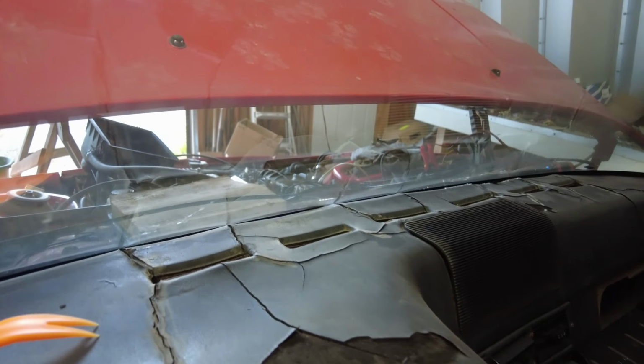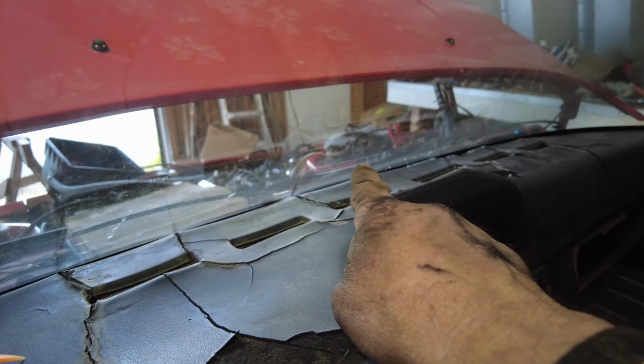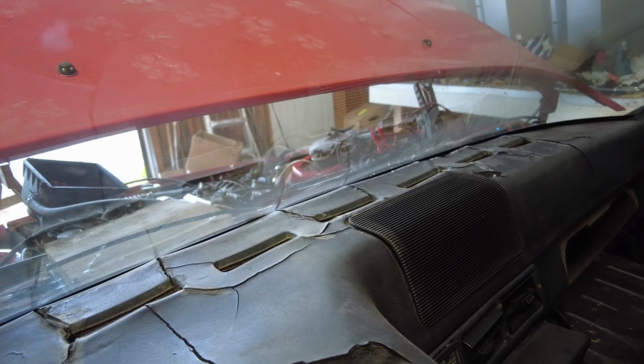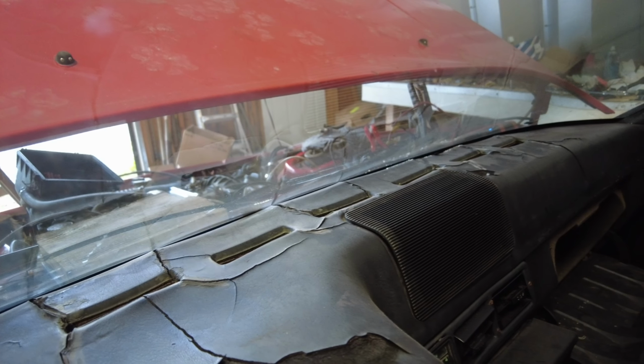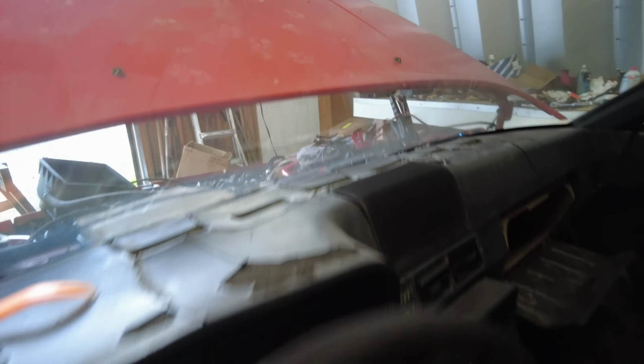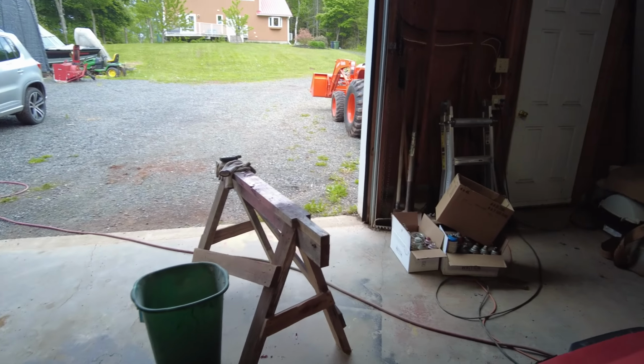We'll see if there's spark in number 3 now. It was also wet, so there's fuel getting in there. You might be able to see this. I think we're pointing in the right way. Should be pointing right over there. Sort of. Don't know what I'm looking at there. Now it runs, right? So, I guess there was no spark for the first 2 cylinders anyhow.